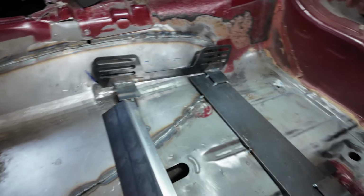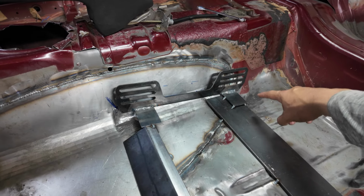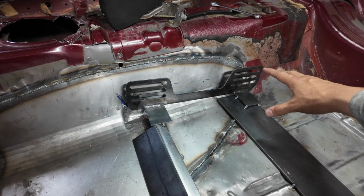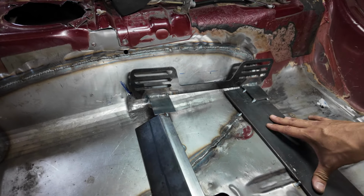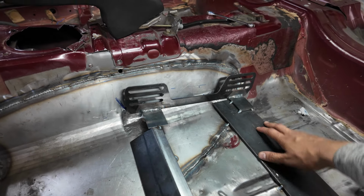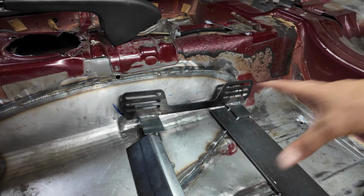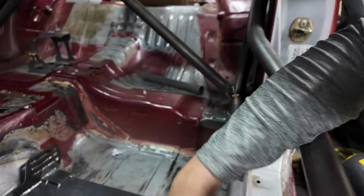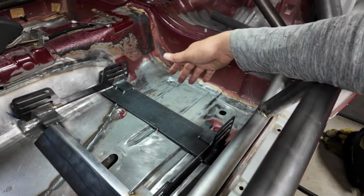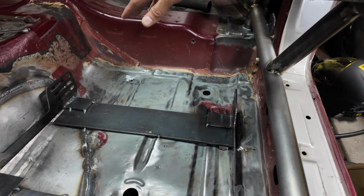The route that I ended up taking is I bought some side seat rail, what are these called, man, seat brackets. I got some side mounted seat brackets, cut off the bottom, added these random plates, square tubing in the front with the flat bar, because I want the rear as low to the ground as possible, and then obviously getting that nice little incline in the front. Kind of figured out my seating position, welded those in, got the seat brackets bolted to the seat, and while it's bolted, I put it down, kind of measured it, took out the seat, and then tack the things, bolt it back on, see if everything fits, and then we're going to finalize welds.